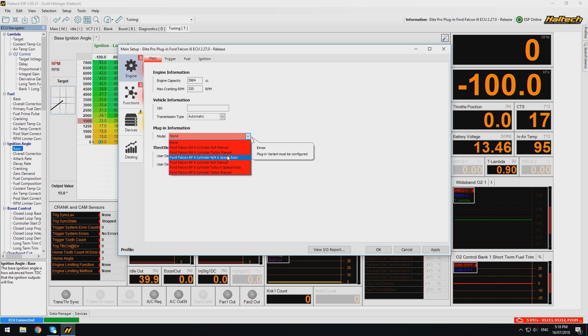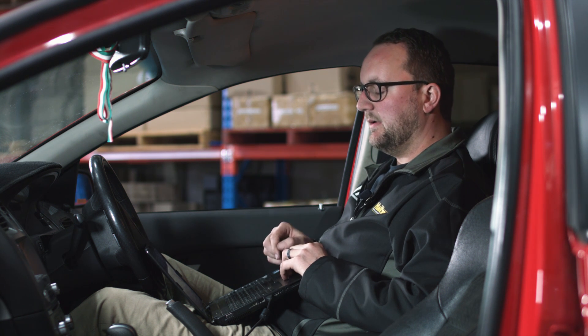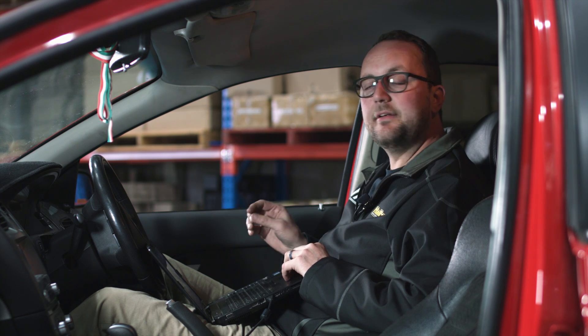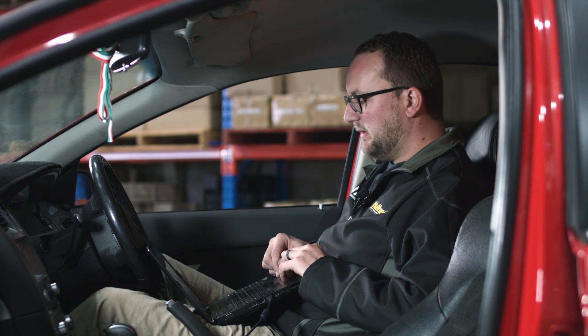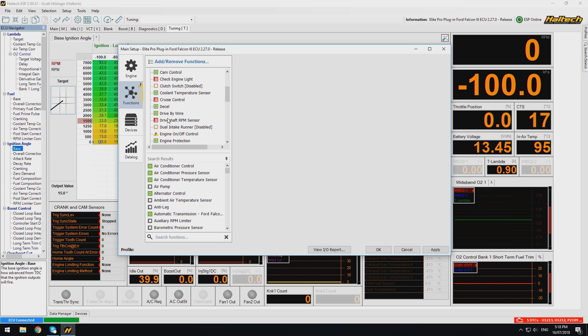Now as I go down, I'll keep addressing all the other parts highlighted in red. The next one: vehicle CAN system. The first setting talked about the wiring pinout — what type of wiring harness is in this car. The second part talks about the CAN messages. So BF, 6-cylinder, turbo, 6-speed auto. Because this car hasn't had a conversion or anything like that, everything is from the factory — the same gearbox, the same harness in this same car. Now that I've set both of those things, I can go through and apply my changes.